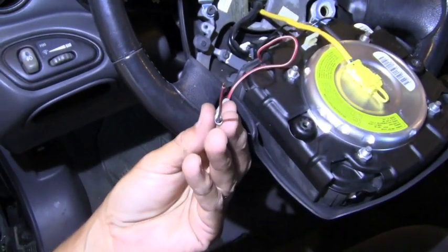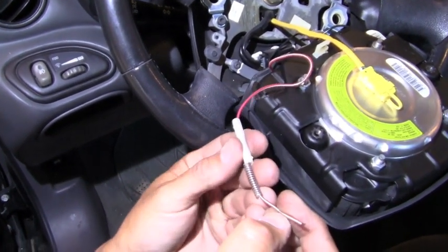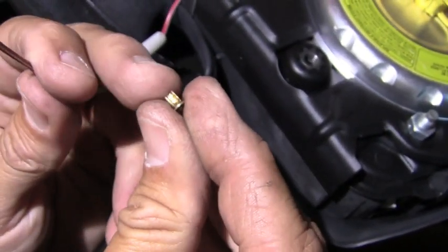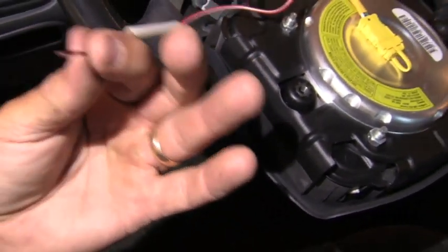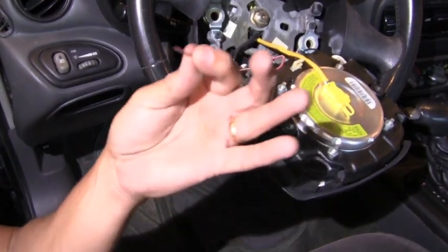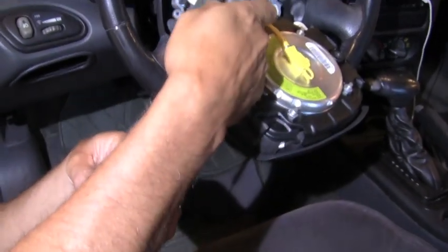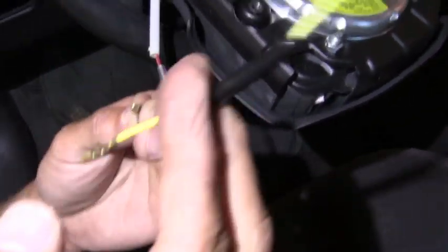As we discovered when we pulled the airbag off, a wire was disconnected from a fitting up inside the column. Once we removed the spring and the retaining piece, we identified that a small brass fitting rides around the clock spring and needed to be attached to the end of this wire. The wire had already been crimped, making reuse almost impossible. When we called to find a replacement wire, we discovered that for this year of Grand Am, they don't just sell the wire — you have to buy the whole airbag just to get the wire and contact.